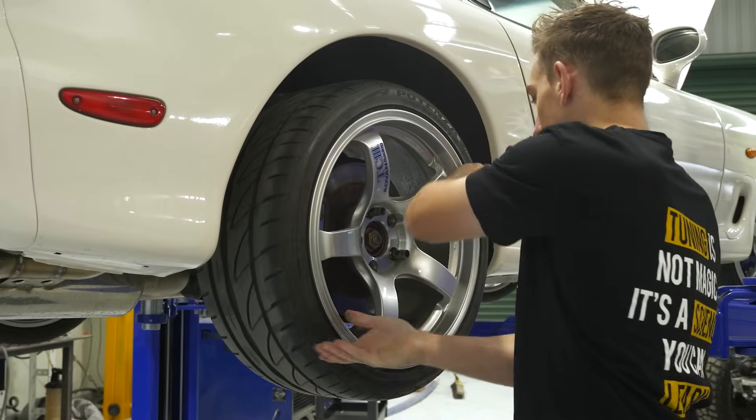Like most things, the less we assume and the more we know, the better our chance of success will be. Also, the spin-a-tire-and-watch-the-driveshaft method only works when the input and output of the final drive are visible. In the case of a transaxle with an integrated final drive — like a typical front engine front wheel drive setup, or a rear mounted transaxle rear drive setup — because the input to the final drive isn't externally visible, we're back to opening things up to verify the ratio unless we're absolutely sure of what's inside. If you're sure you're working with a stock calibration and the wheels and tires are definitely original to the vehicle, you're fine as is. If the tune might not be stock or the tires or wheels may have been changed, I suggest measuring yourself so you can be sure you're entering known good data.